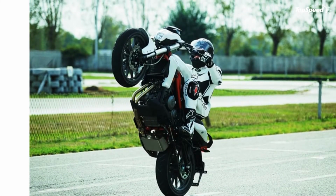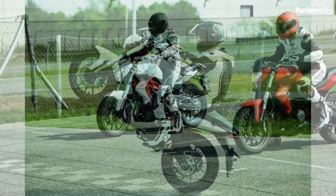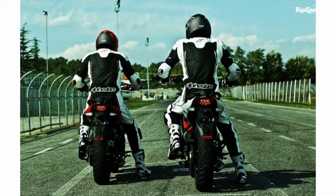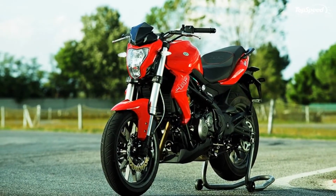Suspension travel at the axle measures out at 5.31 inches front but only 1.65 inches rear, and cornering clearance is reduced on the right side due to the position of the muffler, so you can expect sparks to fly in hard right turns, especially if you hit a bump while laid over.